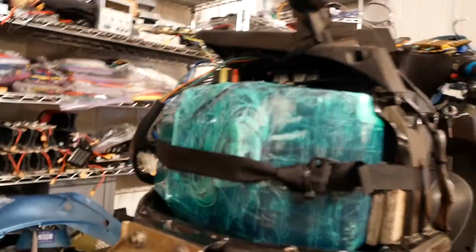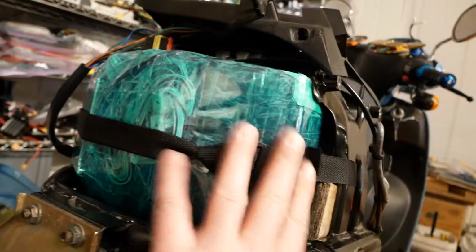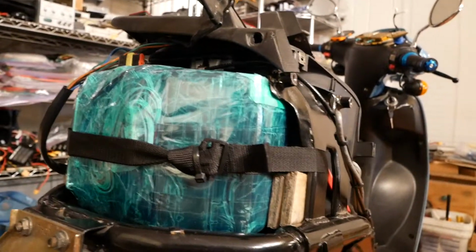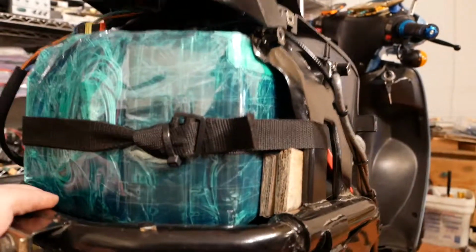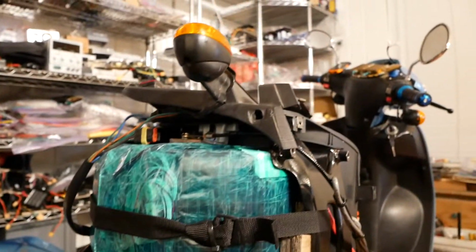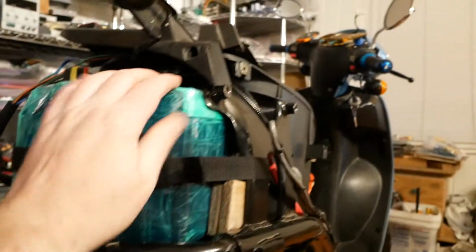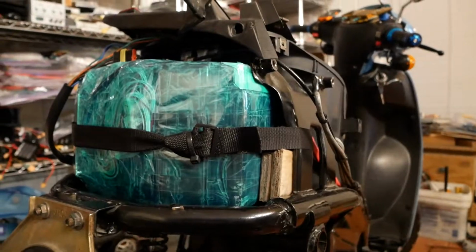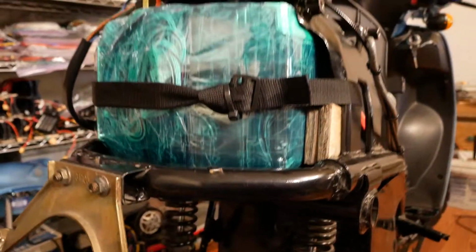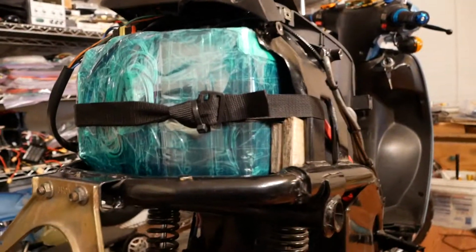Up here, this is a new battery pack that I've just built. I mean, this thing is a week old today because it was getting spot welded last Saturday. And here it is Saturday again, and it's in place and all strapped down. So, yeah, it's literally a week old. But this is all made of 21700 cells. They're rated for 4800 milliamp hours, which really means more like 4300 milliamp hours in real world use. So in 20S10P, that's probably 42, 43 amp hours.